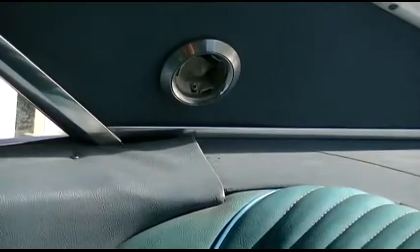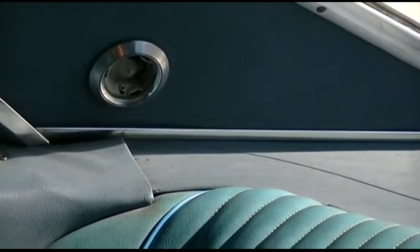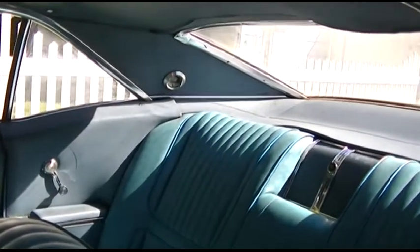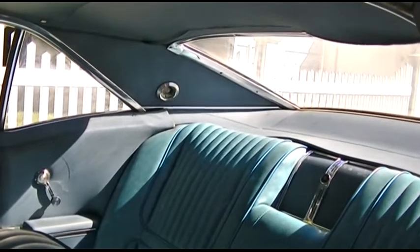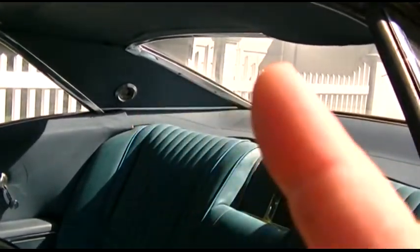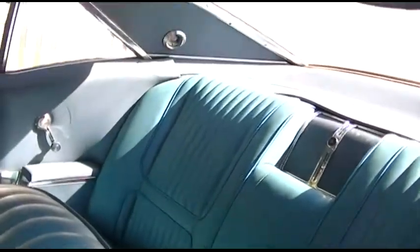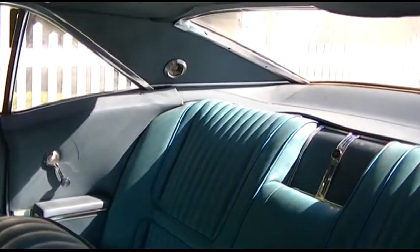This is the fuse that blew in the Buick. This light was out in the back panel — that's called an opera light or sail panel light — and my dad gave me a bunch of bulbs. One happened to be the right size, so I said, let me just change it. I didn't realize that when I pulled the old bulb out, it had two little solder blobs on the bottom instead of one, using the round collar as the other terminal. So when I put the single-blob bulb in, things stopped working.